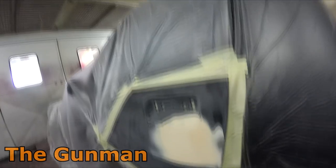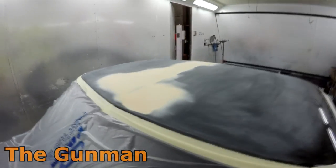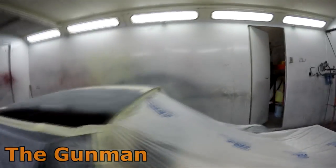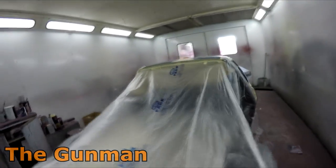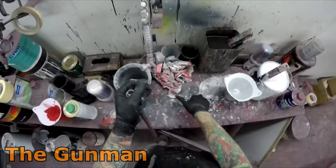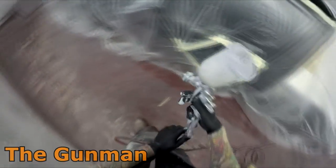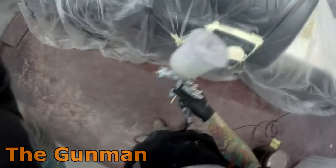He also did the welding — he got some steel and put it in from behind where those locks were, cut them out in a couple of little squares. It was easier to cut the steel into the correct size rather than trying to cut a circle, so you haven't got any hole saws and there'd probably be a larger section to bridge the weld. He just cut them into squares, welded new sections in, put the body filler in, sanded it out, got it all prepped up for primer work, and then I took over from there.